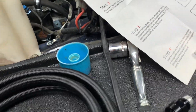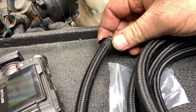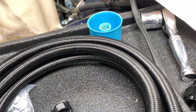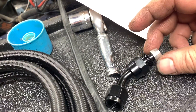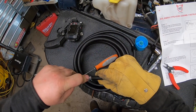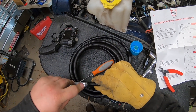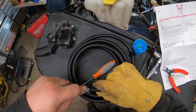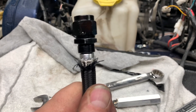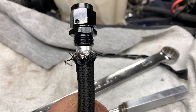This is where I went down the rabbit hole and interpreted the instructions differently. These ones have a ferrule. What you're going to do is take that nut and slide it down on the hose first. The instructions say to clear off a half inch — I originally read that you've got to take a half inch of the braid line and the black off, but you don't. You just clear off a half inch of the black but leave the braided line there. The kit came with a tool, which one could only assume is to keep the inner from collapsing. Use the tool with the ferrule, push down on it, push that piece in, and then your other piece that you put on should just thread up.